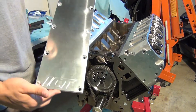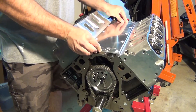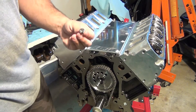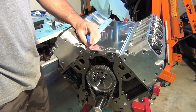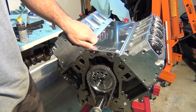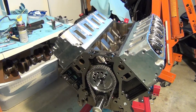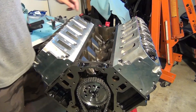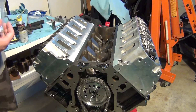I went through ICT and got their aluminum plate — it's really nice, super thick. Fits right on there with the gasket, and it comes with recessed hardware. It looks just as good as the pan. We're also rerouting the cam sensor that used to sit in the back — we're putting it on the front cover for now, and ICT also has a cover kit for that.